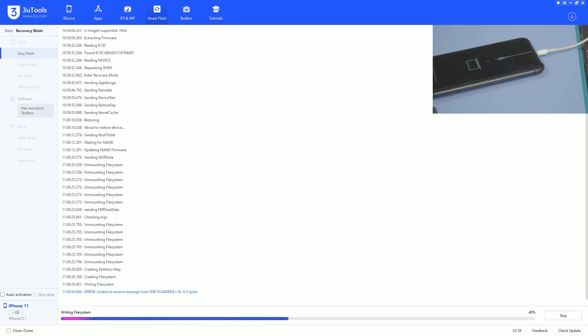And there we go — the phone looped. The tool I was using, 3U Tools, has errored out. So I think what I'm going to do next is take everything off the board apart from the charge port and the screen, and then we'll try and flash the phone again.